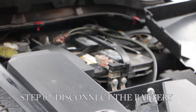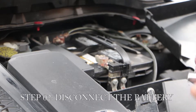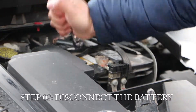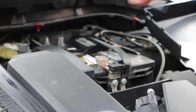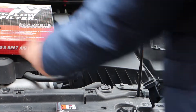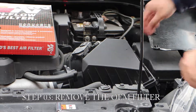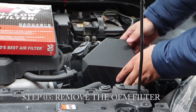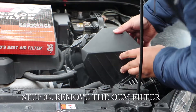So now I'm going to install the K&N filter on the Mazda Speed. First, we are going to loosen up the negative cable to reset the idling. The negative cable comes off. This is fairly straightforward and easy to do — just two clamps here, just tabs down there. You just lift it up like that and it's out already.